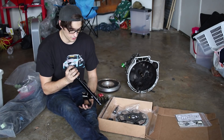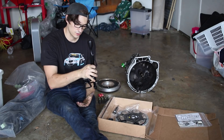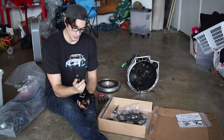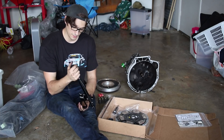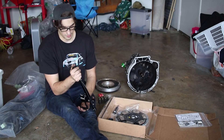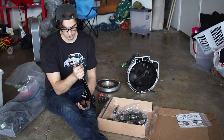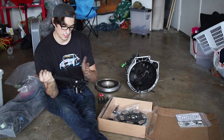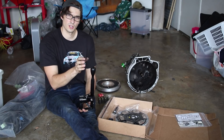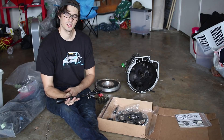This is my Individual Racing Parts shifter. This thing is very dope. It is chassis-mounted, so you just bolt it onto the transmission tunnel — solid everything. It's got a little button for reverse lockout so you don't accidentally slam it into reverse when you're racing. It's got very direct shifting, so all your shifts will be crisp, with adjustable height for changing how short your throw is. It's got a good long shifter so you're not too far from the wheel when racing.